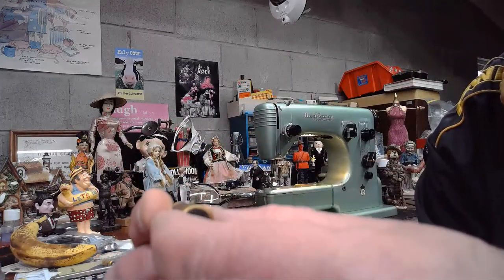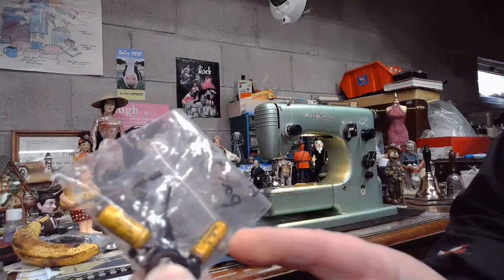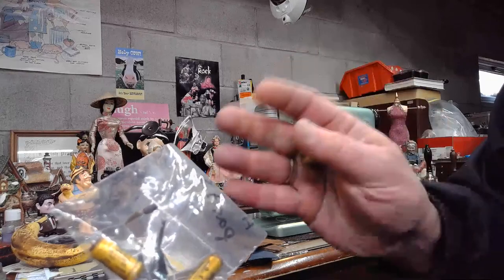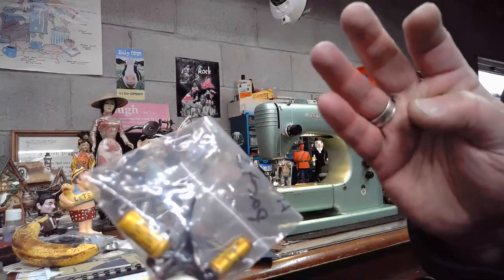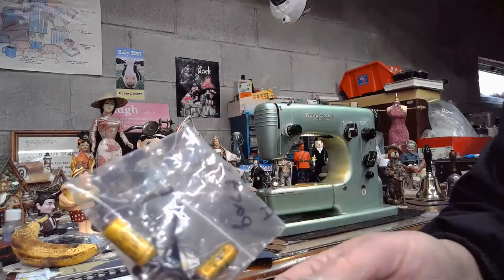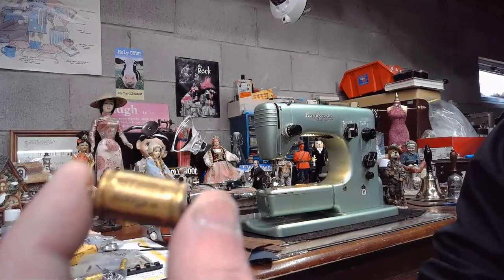And really, this is a dual function device. It's a capacitor and a resistor in one. Normally, the Swedish would use one of each in a foot controller. And if you've ever opened the back of your foot controller, you'll see two components like this. One is a capacitor, one is a resistor. And the resistor is supposed to be that fail-safe that will restrict how much electricity can enter that foot controller and then use that as a gateway to get to the motor itself. This particular foot controller was set up with an older style that served as a dual duty, and it failed. It failed in a major way.